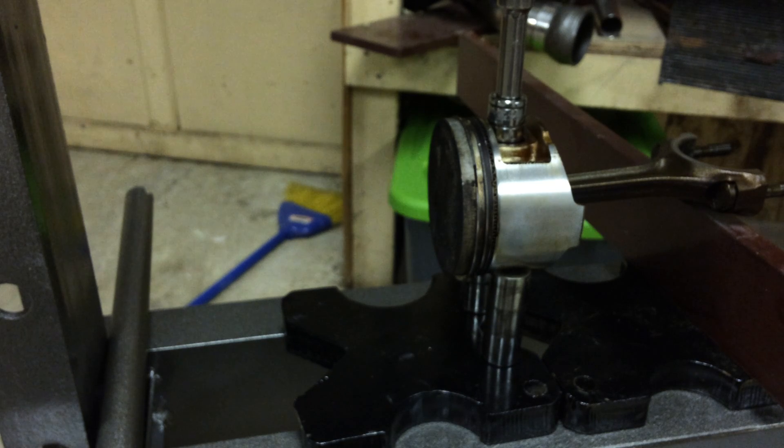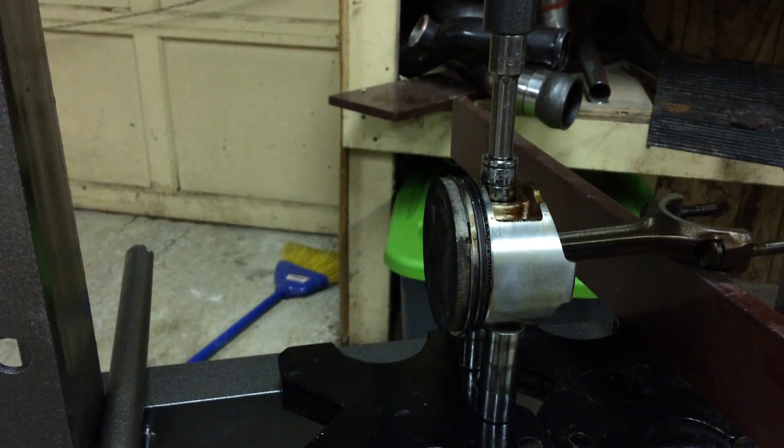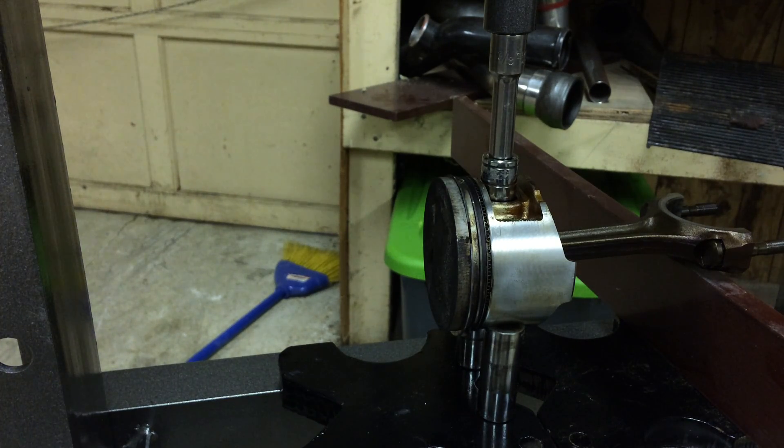These B18 pistons are still good, I don't want to mess them up, so I'm trying to keep them safe during the transfer. It's already locked in place — not super tight, but it's in there — so I should be able to just push through it. You're gonna see it get tight, get tight, get tight, and then you're gonna hear a pop. That pop hopefully isn't the piston breaking — it's the wrist pin breaking free of its press fit hold in the middle.